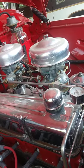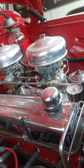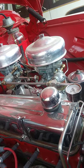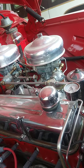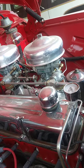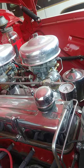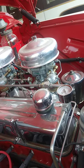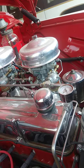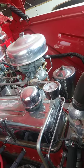New rings, new pistons, push rods are new, connecting rods were reconditioned. The crankshaft was reconditioned and polished — they shaved 10 thousandths off of it, so I got 10 thousandths plus bearings on it. New oil pump from Napa.